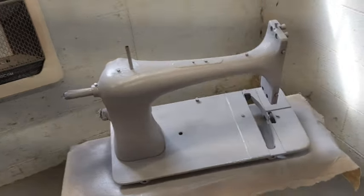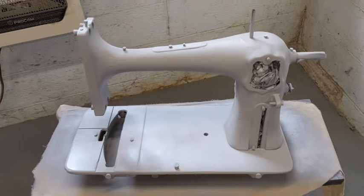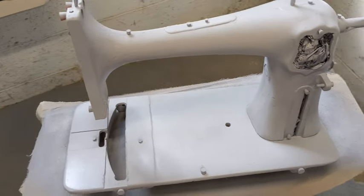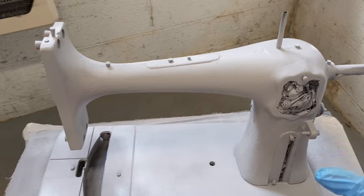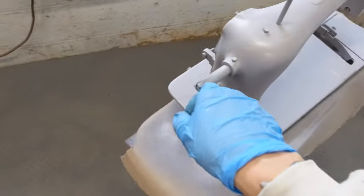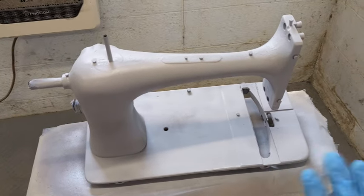I just put the second coat of filler primer on her. The thing about the filler primer is it's going to go on rough. My first coat is not as heavy — I put it on, let it dry ten minutes, and then come back with a very clean microfiber cloth and basically buff it. I do that until she feels smooth, because when she first goes on she's going to have a texture. Once she is all wiped down so she feels very smooth, I pull the little plugs out while I do that, put the plugs back in, and then give her another coat. My second coat is heavier.